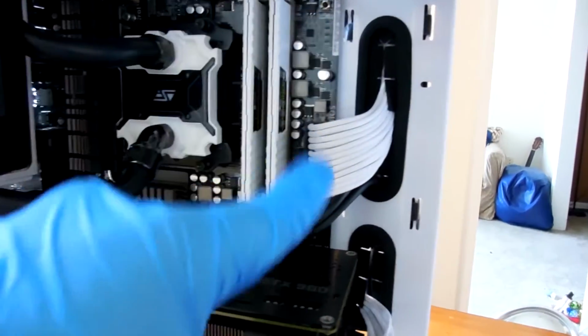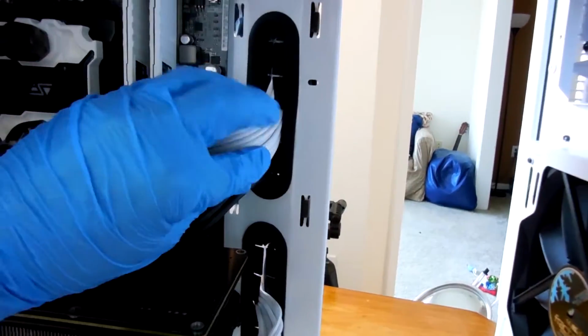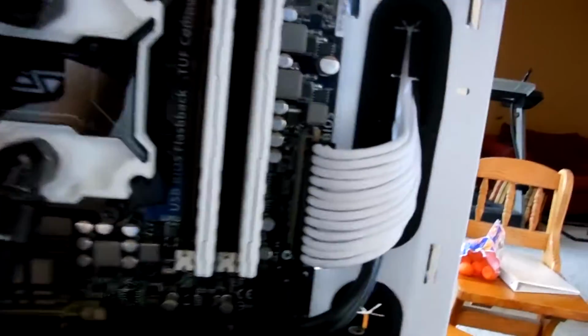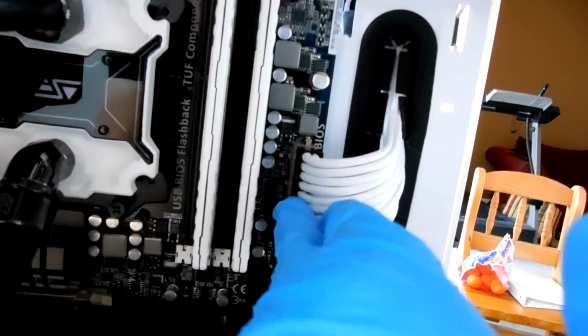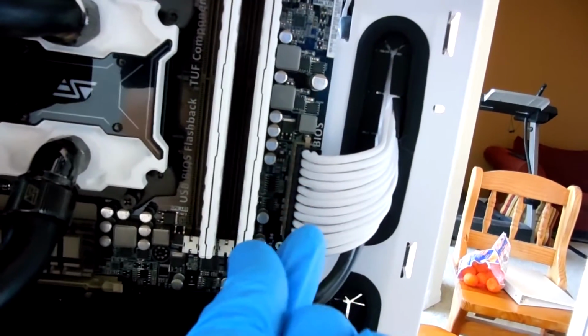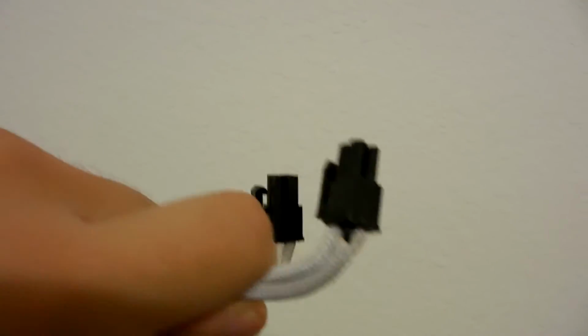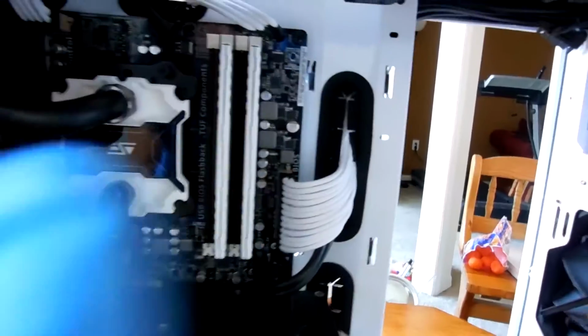Now, when you start actively managing everything, don't pull these cables particularly taut. You want them to look like it's a nice tight run, but you don't want them overly tight, because especially with these heat shrinkless extensions here, the more stress gets put on these over time, the more likely the end is to start separating from the cable. And that does actually look really bad when that happens. So just keep that in mind when you manage the cables here.